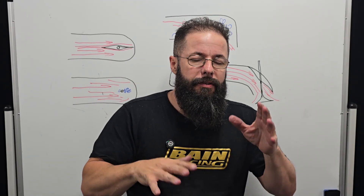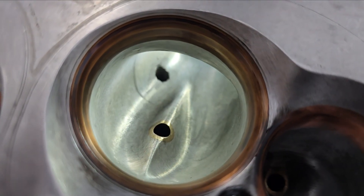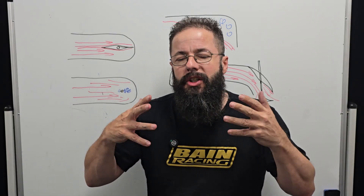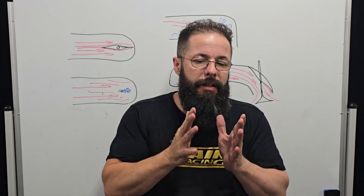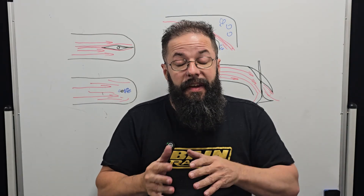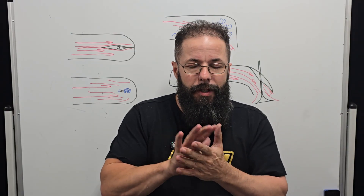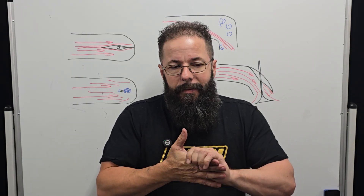I did cover this in our induction secret series but they were a little bit long, so I'm just going to do a dedicated video and explain what the guide fins do — similar to this one. They've actually advanced our cylinder head flow, not only our flow numbers but our port efficiency and everything. It feeds off the videos we've been doing talking about irreversible density losses that ports create, and having a guide fin — the better the shape it is — the more it reduces these density losses in the port. So I thought I'd break down why it does what it does, and what we're actually trying to achieve with a valve guide fin.